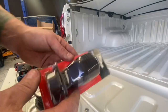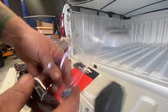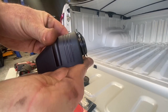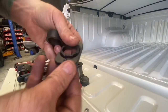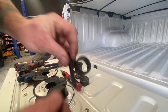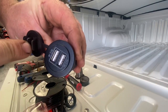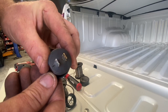So this is the power socket. This is from Jaycar, they're about $18. It's a Powertech 4.2 amp — it has two 2.1 amp sockets. It comes with an assortment of different brackets so you can flush fit onto something if you want. There are also a couple of different fittings to mount onto a flat surface, or a pod mount style as well. We're going to run the direct socket straight into the door card with its two sockets. It has a blue light that lights up, and we'll run this straight in to some power and earth.